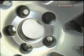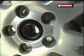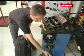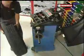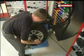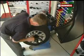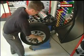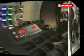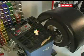In traditional balancing, we use a standard backcone mounting system that has been around since the 1960s. A cone is mounted on the balancer shaft and the wheel assembly is positioned on the cone. A clamping hood secures the wheel in place for the balancing operation. Alternatively, a frontcone mounting system is used either to prevent scratching alloy rims or when backcone mounting is not possible due to size or interference problems.